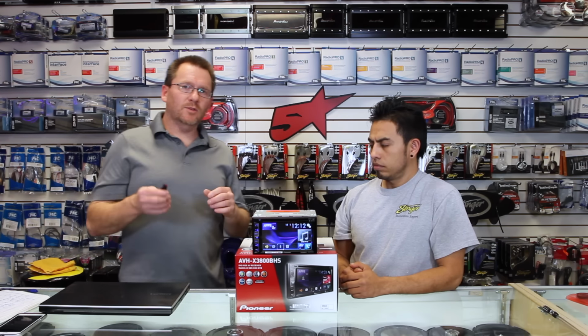But if you're successful and you get to this point, what you're going to do is plug it in. So let's get to that. Now these radios all come with USB extensions. So you just plug it into the USB extension. Okay, go ahead and hit home, hit AV. Hit source off, so you see this screen right here. Come over here and hit the gears. Scroll to the bottom of the page, hit system information, hit firmware update. Click continue. Okay, it's going to give you a cool little warning. Click start.